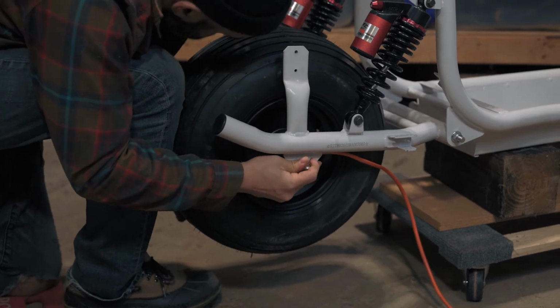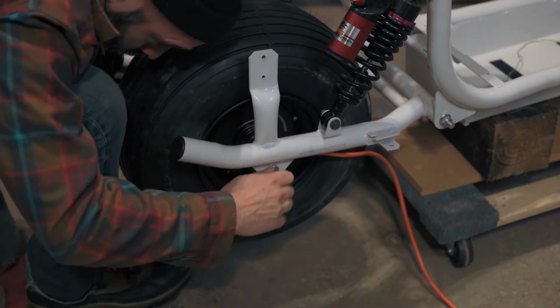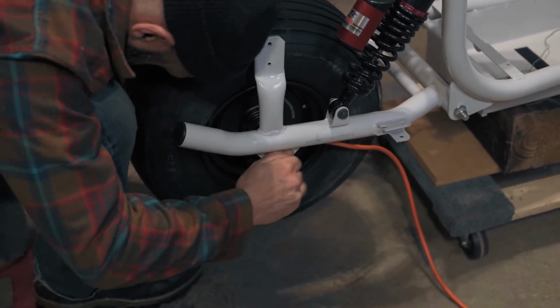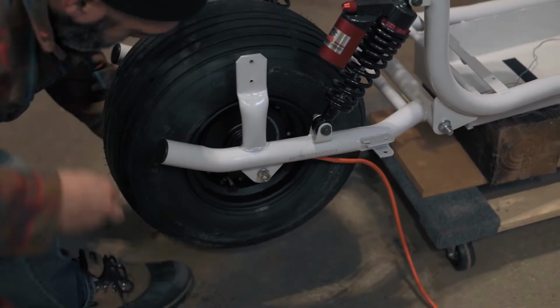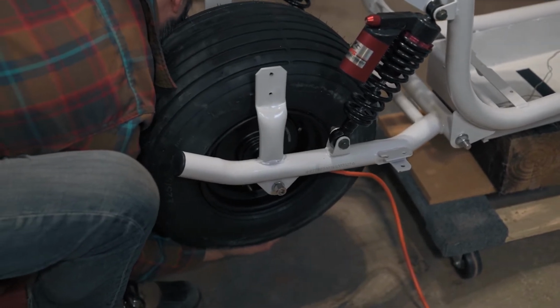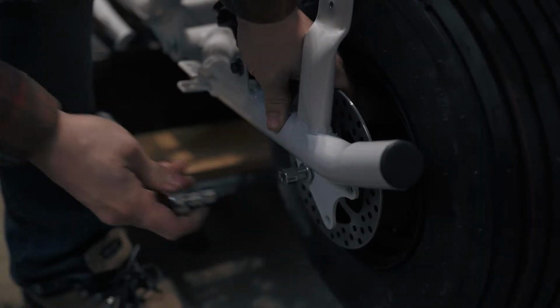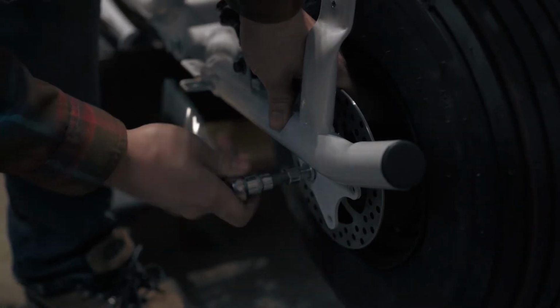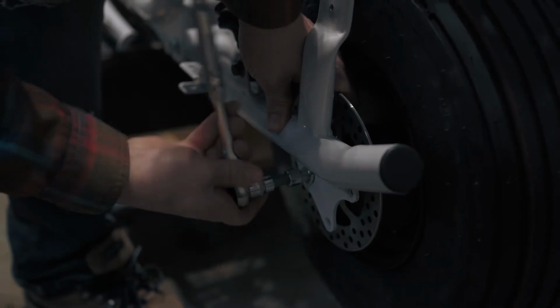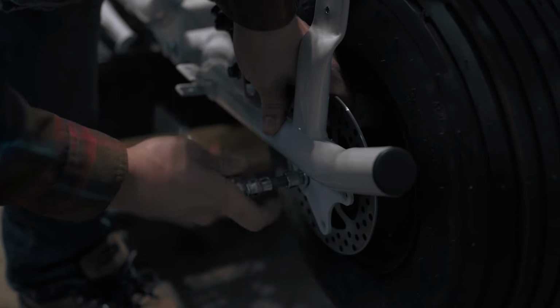The tire is fixed in place with 2 screws, one on each side of the wheel. The rear wheel has a built-in motor that makes it much heavier than the front. If you don't think you can support its weight, shim it up with some wood. Use an H10 Allen to tighten the screws. Torque the rear wheel to 25 Newton meters.